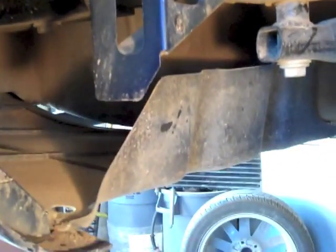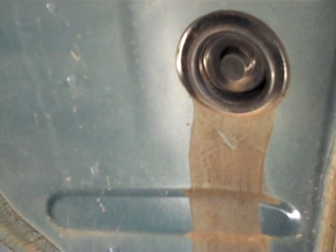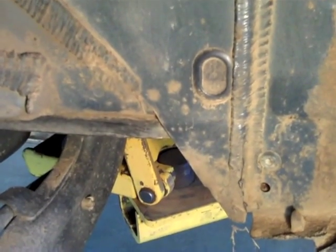I'll take an air hose and clean that all up the best I can before I spray it. That is the wheel well. On closer inspection, it looks as if they did okay at the factory with some undercoating. My evidence for that is these plastic plugs — you can see there's goo draining down from this one. It's quite soft and waxy. It appears as if they did unplug those and put wax, rust preventive stuff in behind there. I'm happy with that.